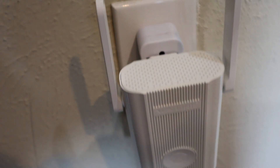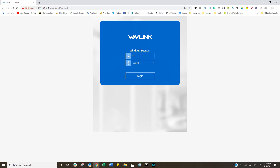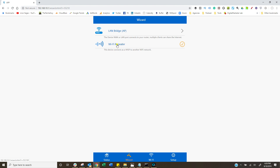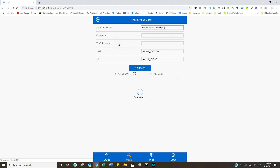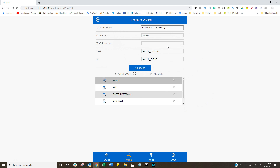Let's plug it in. Now it's flashing red, which basically means the Wi-Fi is disconnected because we haven't set it up yet. First step is to connect your laptop to the new hotspot on your Wi-Fi network — you'll see it's labeled as Wavelink. You connect to wi-fi.wavelink.com and then enter the username and password, both admin, as written on the extender itself. Then you want to connect this up to your local network, select it from the list and enter the Wi-Fi password, so it knows this is a legitimate network you're allowed to connect to. Then click the connect button.